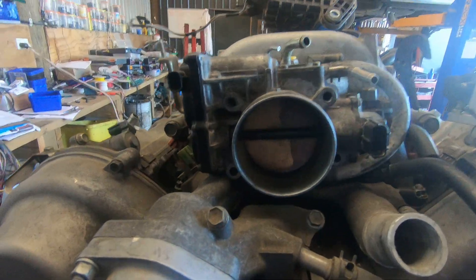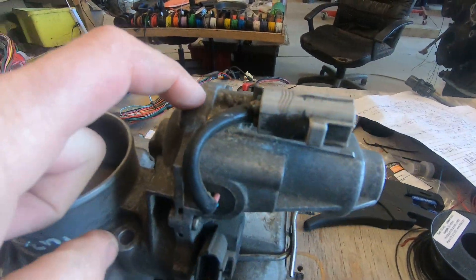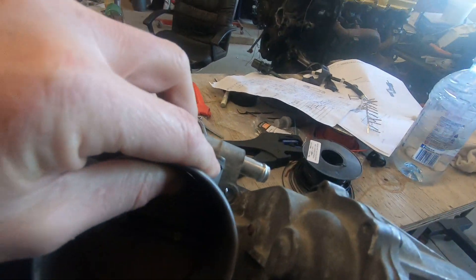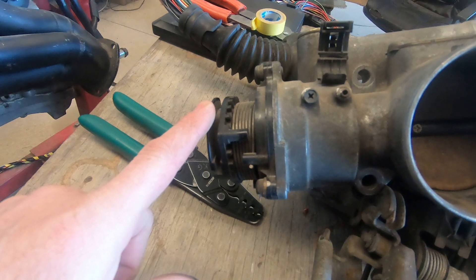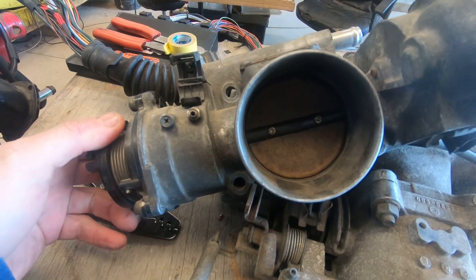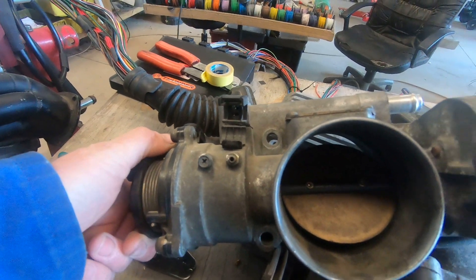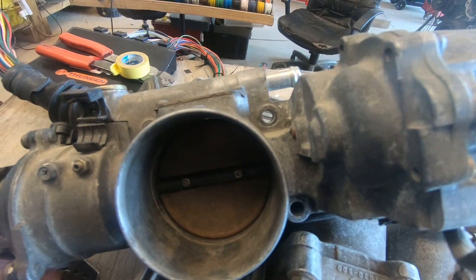Now the VVTi 1UZ has this monster - it's got a motor on that side. But apparently, because it's got a throttle cable, it's not drive-by-wire. Let's have a look. So I'm turning the throttle cable and the butterfly is opening until about two-thirds to three-quarters, and then it opens just a tiny bit more - that's all. Can you hear that? There's definitely some gears going on in there.